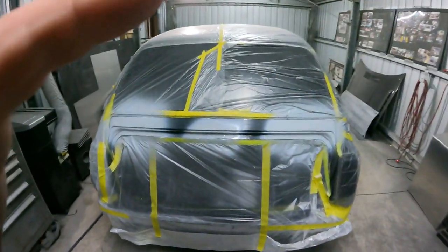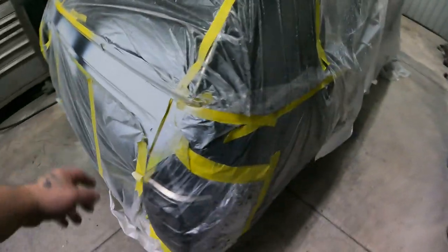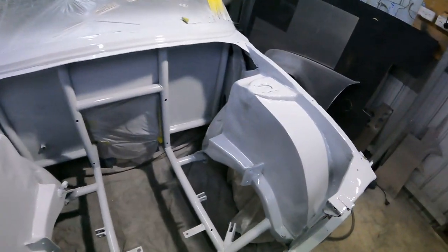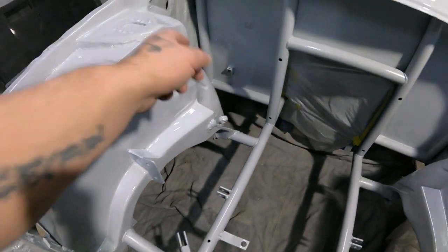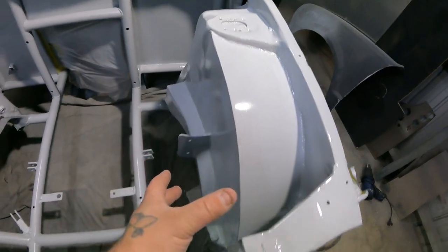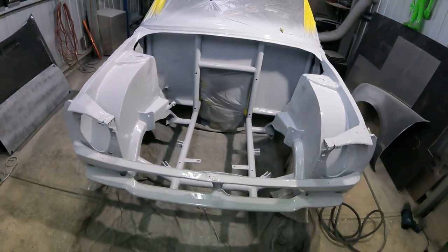All right peeps, all done. So that's the rear of it — just the two little tiny bits there on either side. Everything's come up well. Just got to put a bit of heat into it and yeah, the engine bay's all primed up — that's the high-fill. Now wait for that to dry and then we can come back and go over the little tiny bits I've missed with a bit of bog. As I said, we're mainly going after these parts — the two front wells — just to get the look right when you look in.